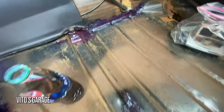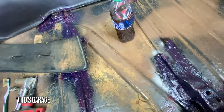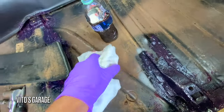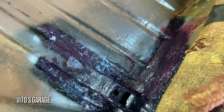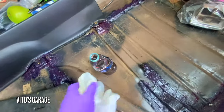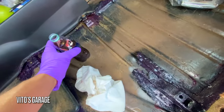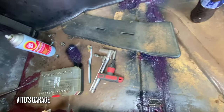Here it is — all preserved with grease in the places where it needs to be. If your sound deadening is completely off, then obviously put grease everywhere. Since there's still sound deadening here, there's no point putting grease on top of it. Everything is good in this area and the seat is basically ready to be installed. I'm just going to pour ATF in here so it flows all the way through to preserve that area. Really excited to put this car back together on this side.